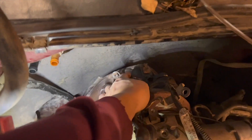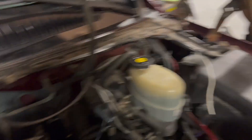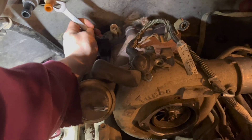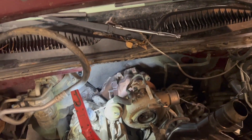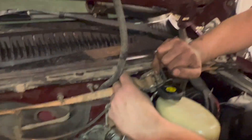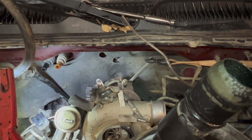These bolts right here are a 12mm 12-point and they're kind of a pain to get at. The trick we found works best is you just get a little wrench on there, then get a ratchet strap and tie it to the cross support beam. You put that on there and crank it super tight — it's tight but it cracks it loose. Just get the ratchet on there with the wrench, crank, and boom, works like a charm.